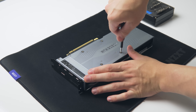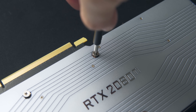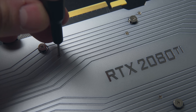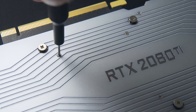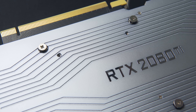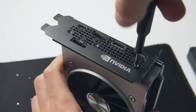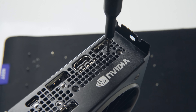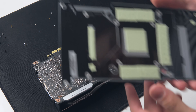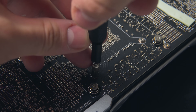Start by unscrewing the four main mounting screws that hold the cooler to the GPU — they won't fall straight out, so just make sure they're loose. Next, remove the two medium screws next to the IO shield. The tiny delicate screws are up next — make sure you've got the correct size screw head as they are quite small and there are a lot of them, so take your time. Next up is the IO shield, which has two different size screws but all need to be removed as the IO shield attaches to the cooler. At this point you should be able to remove the backplate and the thermal pads from the PCB — be careful not to tear them.